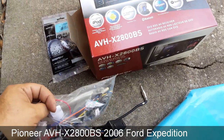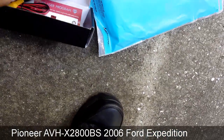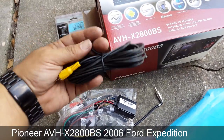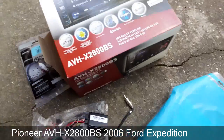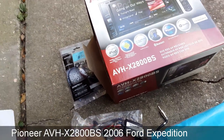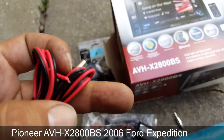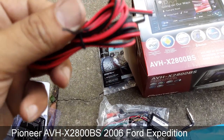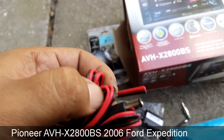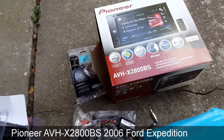The only other thing you're going to need to know is where the reverse light is. Once you hook up the backup camera, this long wire is going to go all around the trim. You're going to hook it up to get video and audio out of the camera, and you're also going to need to figure out where to give it power in the back. You'll need to find the reverse light wiring in the trunk area and tap into it so the camera turns on when you put it in reverse. It's going to be an all-day installation — I'll give you updates once I get it all put back together.